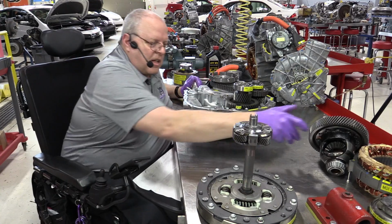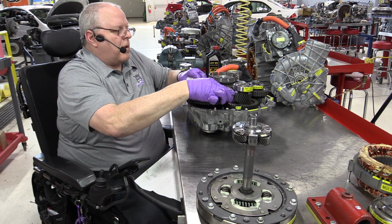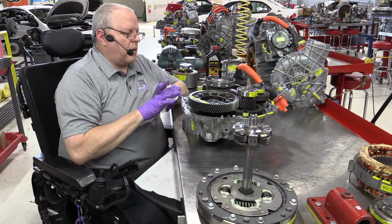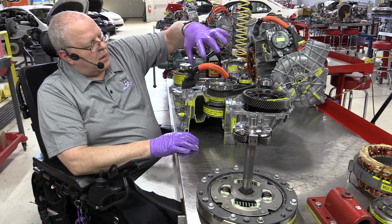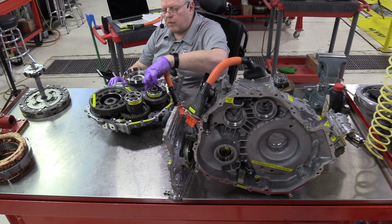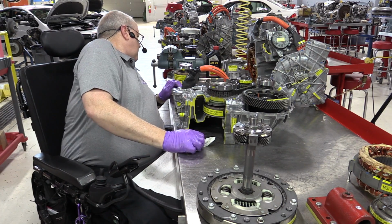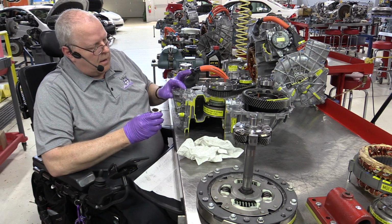Okay, so the next thing is our final drive gear differential case. By the way, the parking linkage on this transaxle is exactly the same as the P111, except for the electric motor that actuates it. All right, so we've got our chain. So we've got our drive sprocket, our driven sprocket, with our counter drive gear driving the counter driven gear, driving the pinion gear, driving the final drive gear, and the overall gear ratio of all of that is 4.113 turns of MG2 to 1 turn of the tires and the final drive ring gear here.